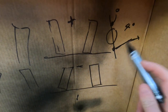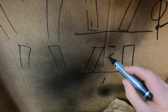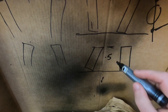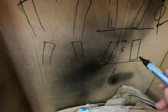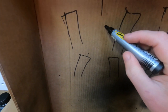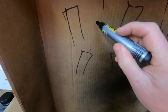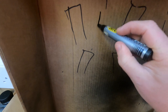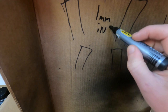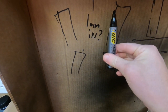What we're looking for is to get round about standard caster, which I think is about four degrees - somewhere in that ballpark. We're going to go negative camber 0.5 degrees - we'd probably go more on smaller wheels but it's running 13s at the moment. For tracking, I think it's a tiny bit of toe-in but I'll check that before setting it. The important thing to start with is to try and get it parallel.